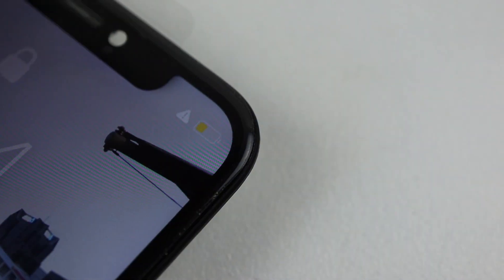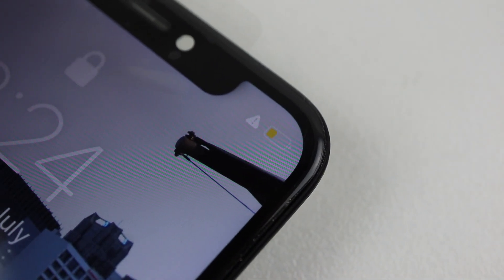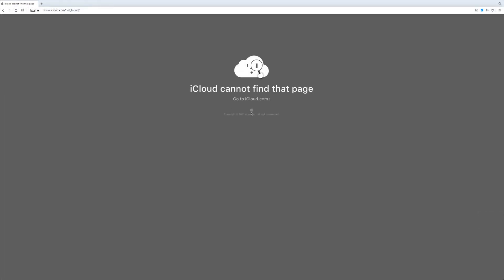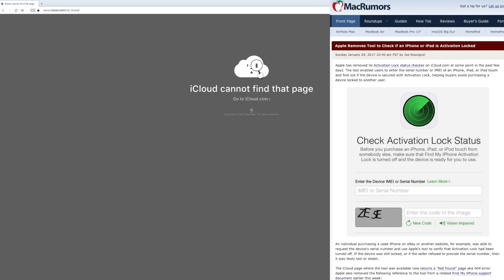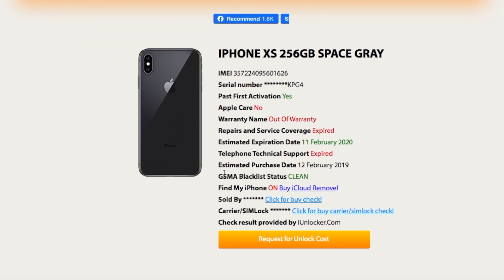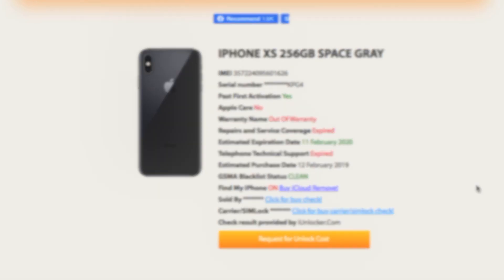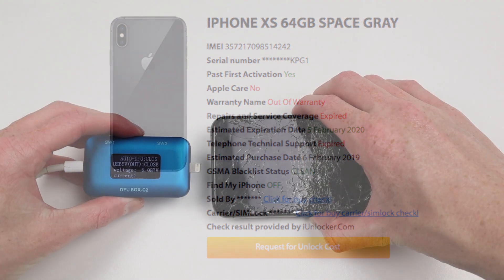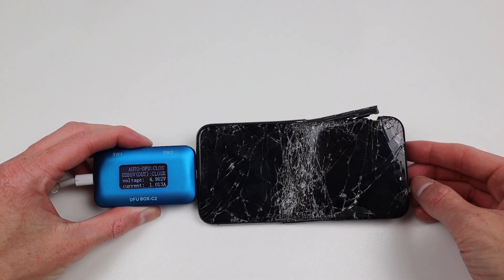This message will also trigger a little warning icon in the status bar. Before we go any further, we need to first check if it's locked. Apple had an awesome tool to check whether a device would activation lock if reset, though Apple removed this tool, so we'll now need to rely on third-party websites that aren't always accurate. Typing in the IMEI number, we can see this is a 256GB iPhone XS and activation lock is on. This means if I reset the phone in iTunes, Apple won't allow the device to activate and be set up, even though the phone isn't lost or stolen — the last owner has to remove it from their iCloud settings. As for our other iPhone XS, it's a 64GB model and has Find My iPhone off, so there is still a chance for this one.